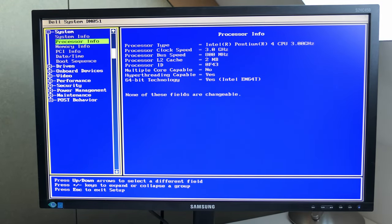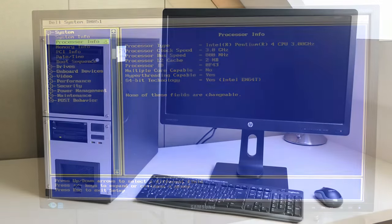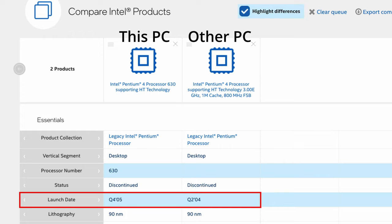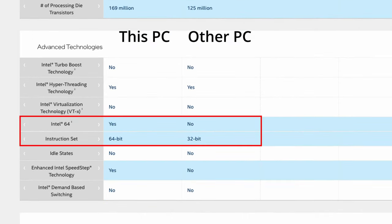The CPU is a Pentium 4 running at 3 GHz, which you already knew. That's interesting as I recently did some benchmarks with another Pentium 4 at the same 3 GHz — there's a link in the description if you want to find out more. Although the clock speed is the same, this CPU is of a newer generation: the so-called Prescott 2M. It adds another megabyte of cache and has the 64-bit extensions enabled. We'll see how this affects performance.